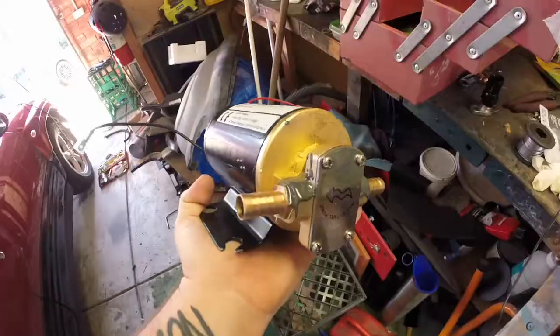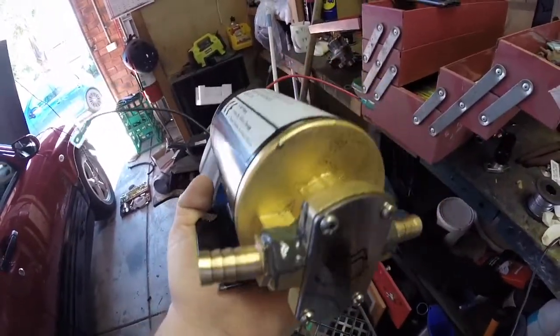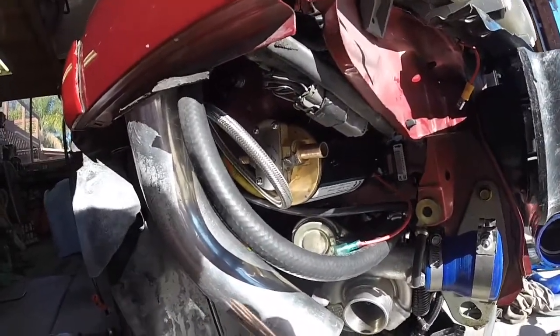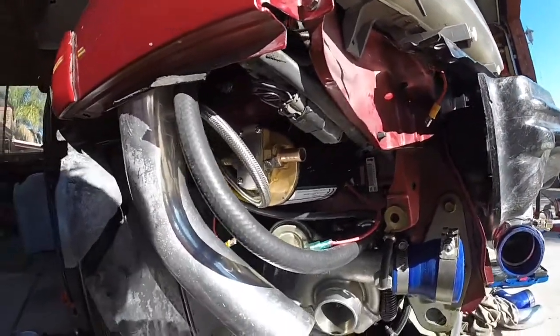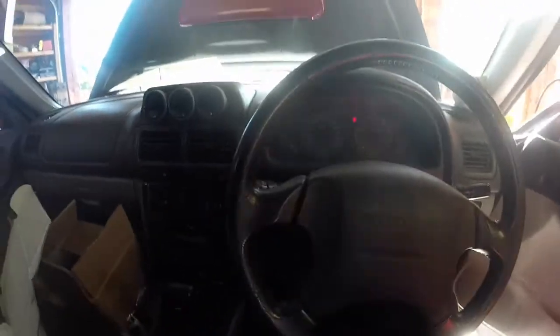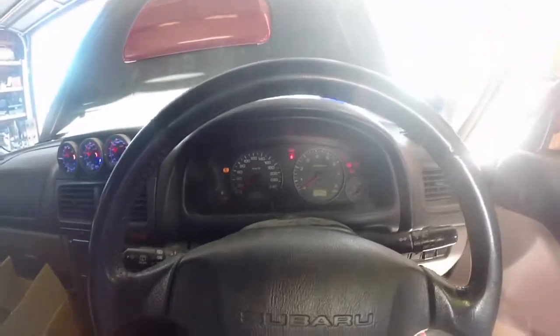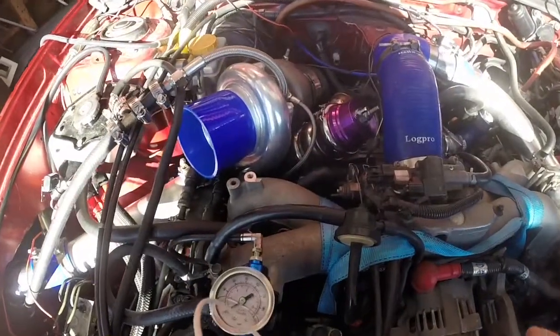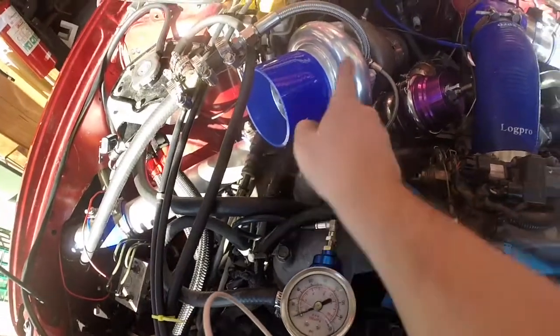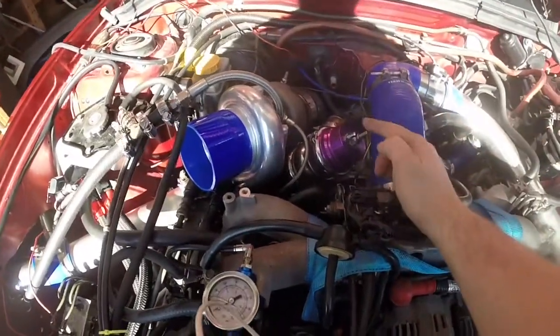Time to get the scavenger pump back on. Glue is dry — I did glue it in with the barb in there, just to make sure it won't leak. There we go, got it back on. I'm not going to show you too much of the scavenger pump as you've seen it in a few videos already. I'll just hook up all the hoses. Pipes are up higher than the exhaust now. The main thing I need to do now is plumb in the wastegate to the intake of the GT35, so I can actually see how much the GT35 is running. Also put another boost gauge in there so I've got two.